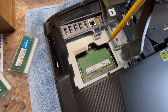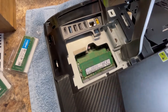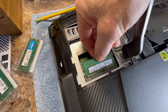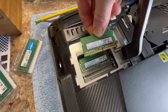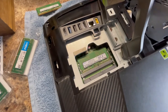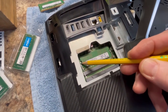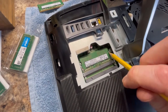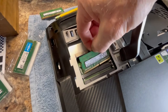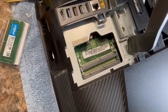It's a rather simple procedure. You just take the clips here and push them each sideways, and the RAM just pops right up like that, then slides straight out. Then we disconnect and unclip the bottom one on both sides as well.